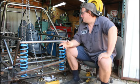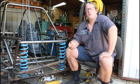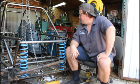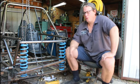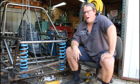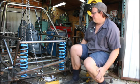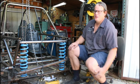So there's real aftermarket support for those transmissions. So my thought was, well, I'm going to buy one of those, and maybe I can figure out how to build a close ratio and get some lower gears out of it. But then as I was looking into the transmission charts, I actually found one that already has a 4.23 ring and pinion final drive, and I'm thinking, well, that's pretty okay, because I know in the buses you can get up in 5.38s and 6.38 ring and pinions, so you can still go lower, but in your standard Volkswagen Beetle, you're using a 4.11.